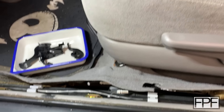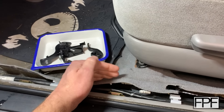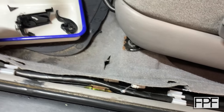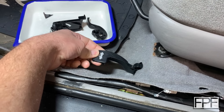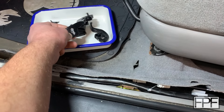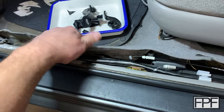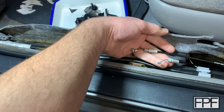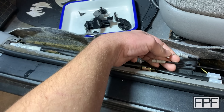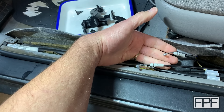We're over here at the car. This is the driver's side seat, and everything mounts up underneath the seat. There's actually a hole in the carpet where these handles stick through when this is installed. You pull one to open the trunk and the other to open the fuel door. There are two cables that attach into that part. You can actually just pull on these cables by hand to release the trunk and fuel door — you've got to pull pretty hard, but neither one feels like it has more tension than it should.